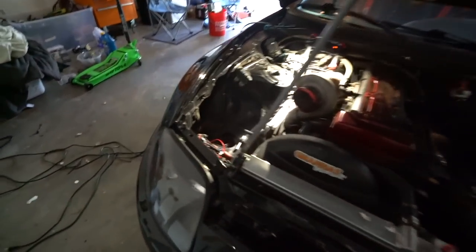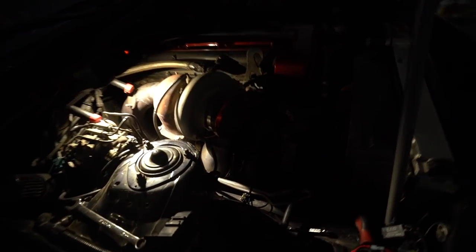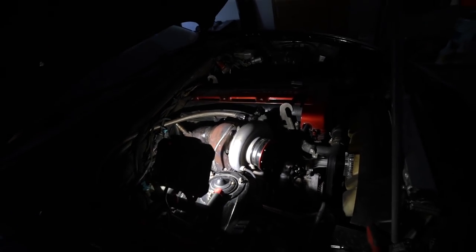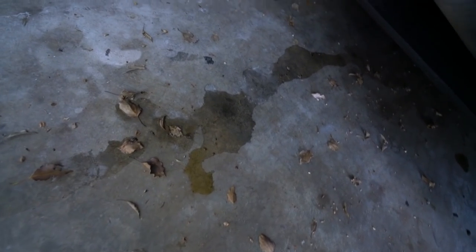It's a really annoying day. We're looking at a feed line down in there that's leaking, and it's causing everything above it to leak as well. So what am I doing? I'm pulling off the turbo. I took her out for some spins and she leaked a lot of oil - and actually oil and water, which is not good.